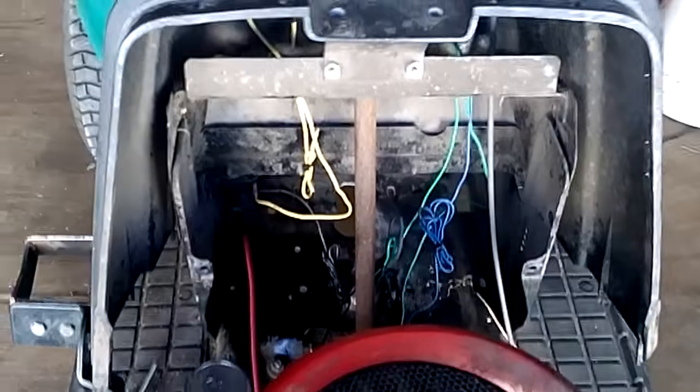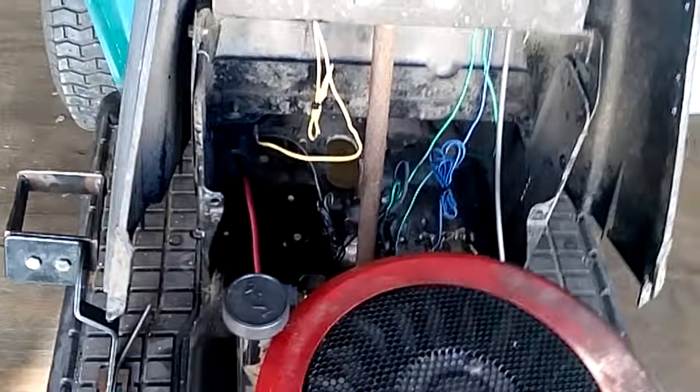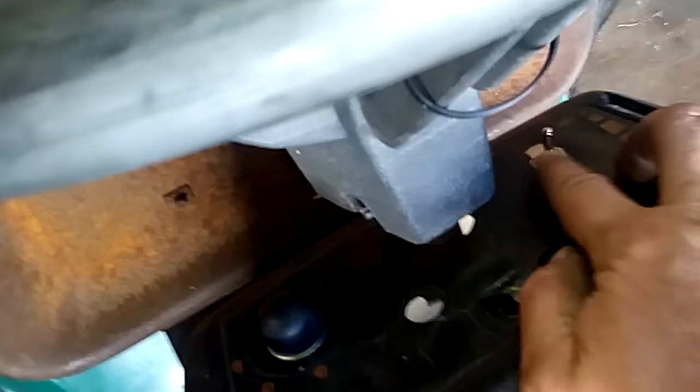You don't have any safety switches. If you want to put one in, instead of the toggle switch put a tether switch in there — that way if you fall off, your mower dies. Anyways, that's it, it's not hard. It's a little time consuming because you got to rip everything out, and if you're cheap like me you snip up the old harness, put connectors on it, heat shrink everything. Anyways, hope you enjoyed — and shout out to Doc, coming after you on that wiring job on the Mule. Later.